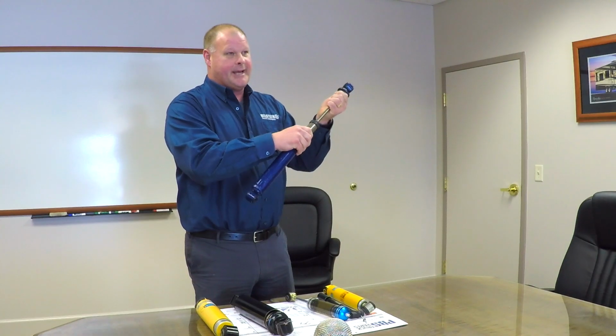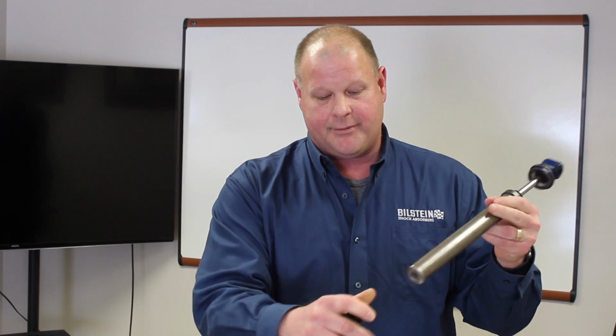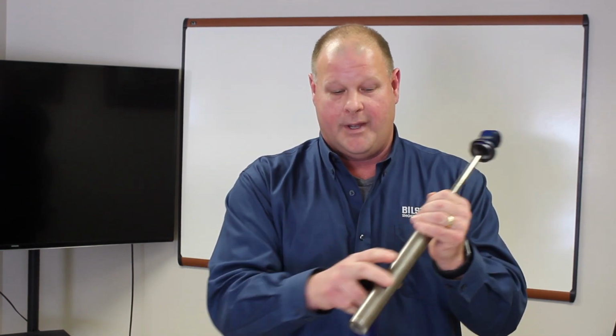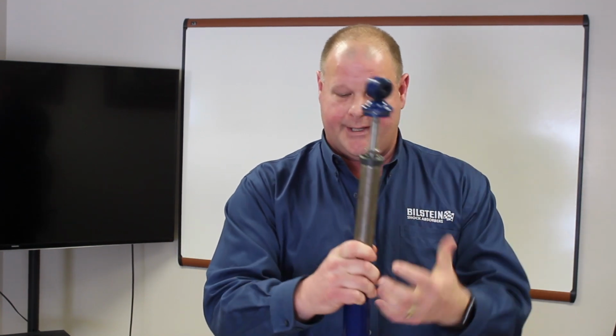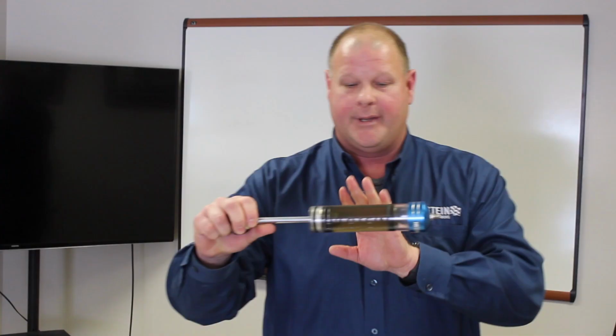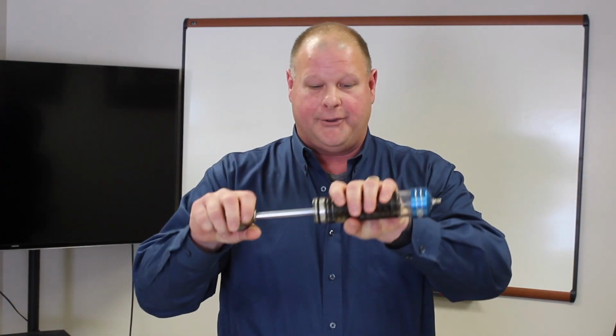So this piston cycles, the hydraulic fluid comes through a foot valve at the base of the shock absorber into this outer reservoir, and then as it cycles back, it brings that hydraulic fluid back with you. With a twin tube design, you constantly have that cycling, so you get a displacement of fluid to that outer reservoir. And eventually the foot valves and mechanicals of the shock absorber fail, and that hydraulic fluid doesn't make its way back in.